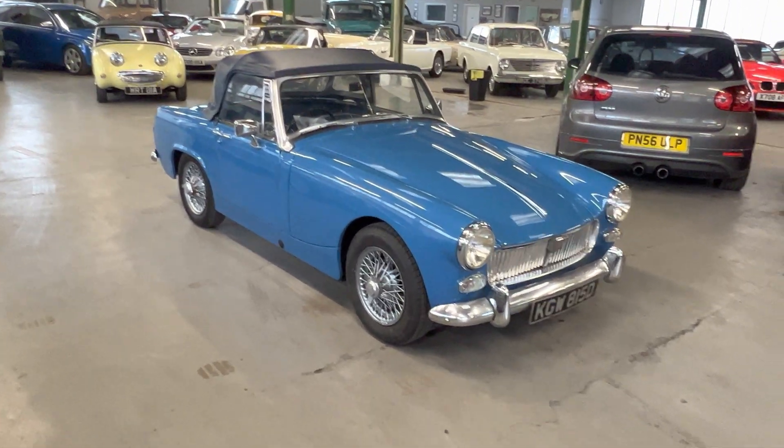The hood is dark blue, contrasting nicely against the lighter blue of the bodywork — a nice touch. It's in lovely condition: nice and tight, no splits on the ribs. The rear windows are nice and clear — they haven't dried out or gone yellow. All the press studs are nice and tight as well. This is a pack-away hood, so you drop it down, lift it out, and put it in the boot or behind the rear seats — the earlier style, rather than the type that's fixed and drops down requiring a tonneau cover.